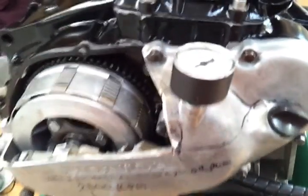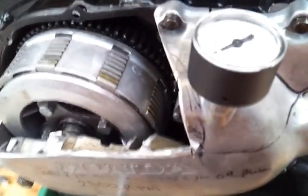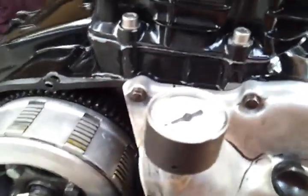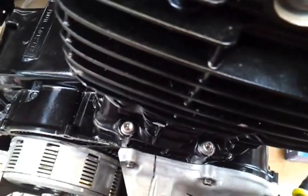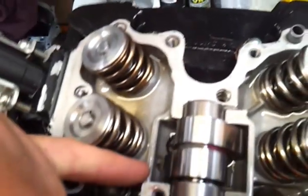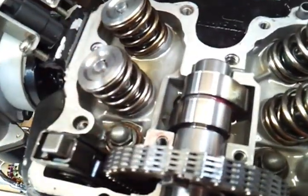So we had to look elsewhere to where problems might lie. What I'm going to do now is fire up the engine, just on the oil pump side of itself, that allows us to see what the oil pump flow circuit is doing, where the oil is going, how much is getting up to the top. This is going to simulate the engine idling at around 1,200 RPM. You'll see the whole layer where the oil comes up through the engine to lubricate the camshafts, and how much oil is up there when the engine's idling.